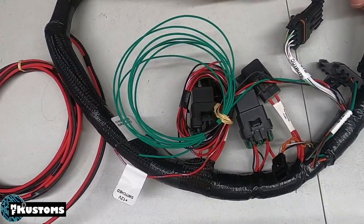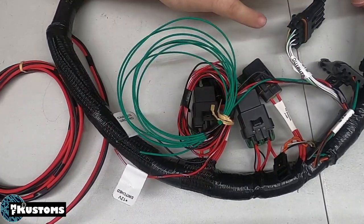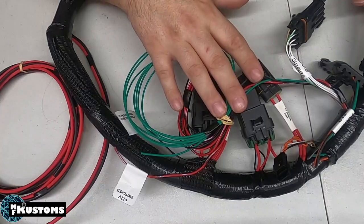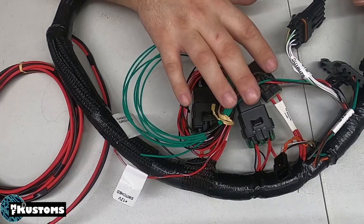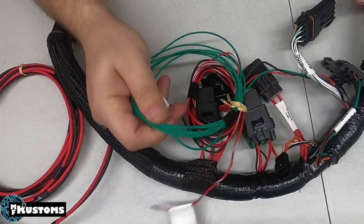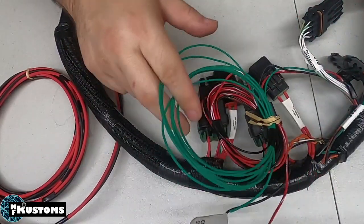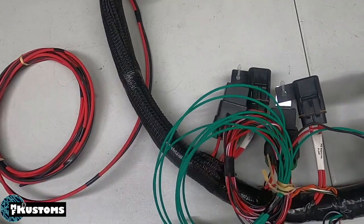There's some wiring we have to do inside the harness to fix the IAC, because we rewire the 558-128 harnesses, or any harnesses we modify, back to all Ford connectors. So we have to do a little bit of changing around for that because now we're doing a shared power source for each injector bank side. Like I said, we replace the fuel pump trigger wire with just a 20 gauge green wire, and we leave plenty of extra wire in here. And that's really about it.